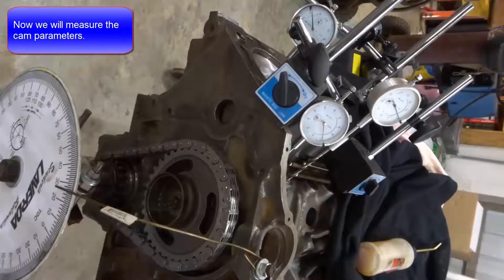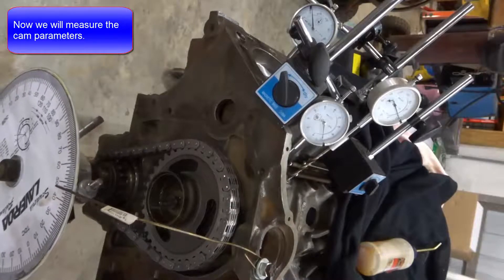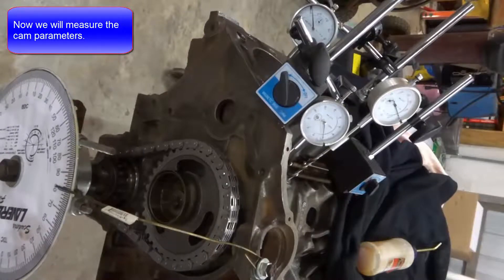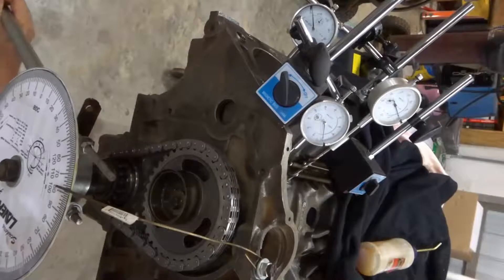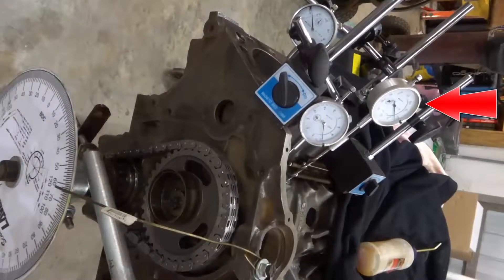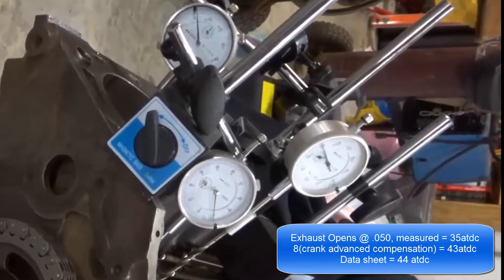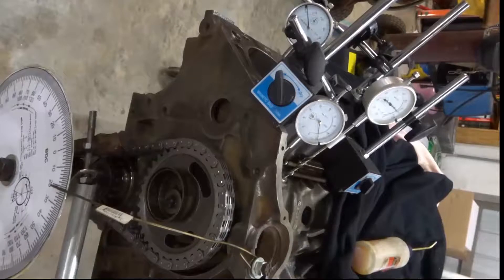I created this portion of the video by recording 720 degrees of crankshaft rotation non-stop, except to change the tool that moves the crankshaft. It captured all the dial indicators so we could go back later and add narration to the video. I also slowed the video down by a factor of 50%. The next event will be the exhaust valve opening, followed by the exhaust valve reaching peak — there's no spec on this so I'm just going to approximate the peak.